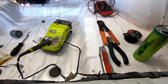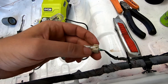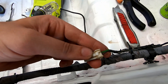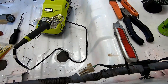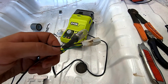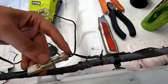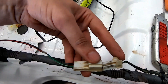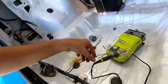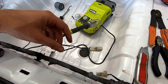Here's me trying to figure out why this light wouldn't work. When I tested the fog light power cable, there's a green wire and a black wire, and I tested both — the green wire is the 12 volt. So I went to connect up the plug on this side assuming the green wire would be positive. But when you line them up, the green wire and the black wire actually swap sides on the connector. Thanks, Hyundai. So I changed that over — the black wire is our positive on this side — and then it boots right up.